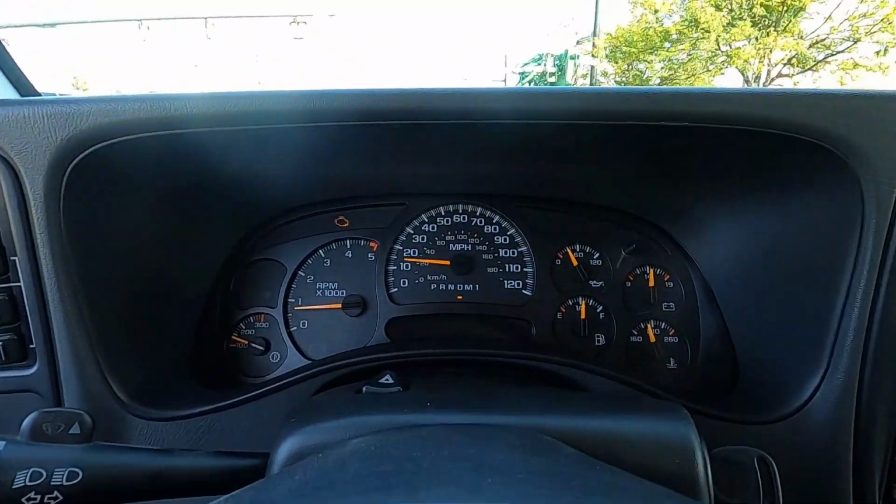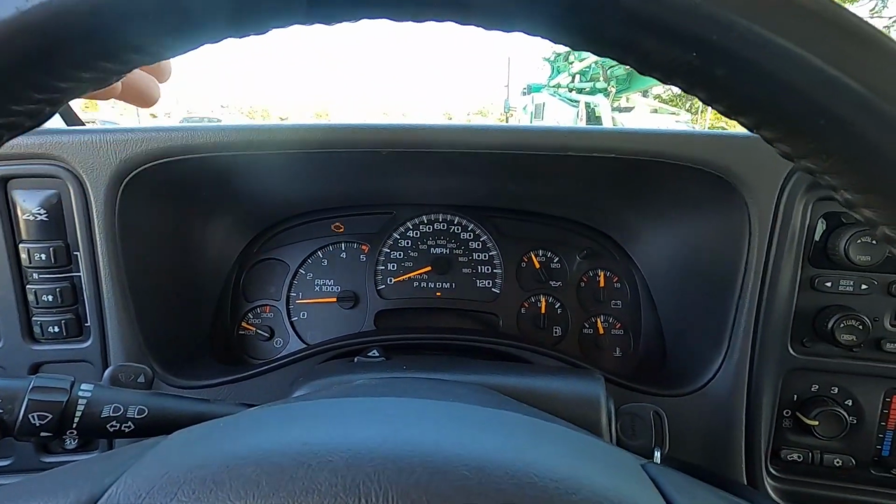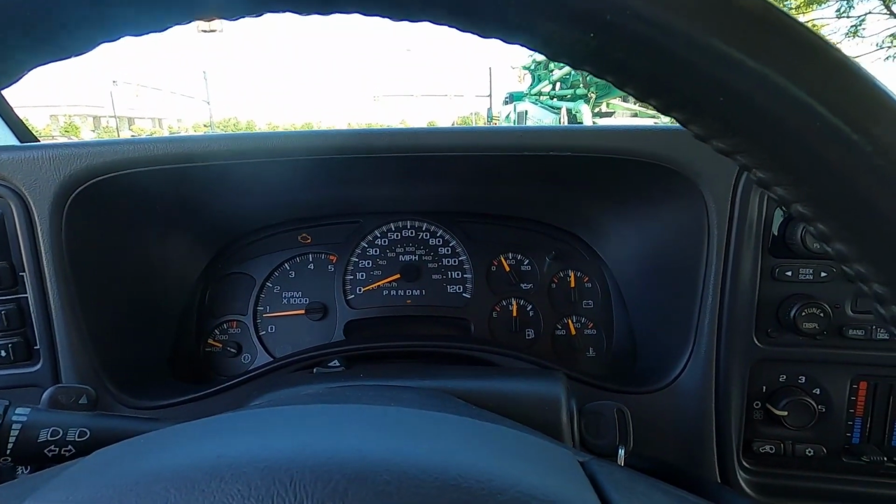This thing is sweet. If you noticed in the last couple of clips, we do have a check engine light on. That is for glow plug number 6. Actually the most inconvenient one to replace. It is right under the steering column or next to the steering column shaft on the driver's side. But what can you do? Everything runs perfect except for that, and this thing does not need glow plugs to start. So these LBZs have glow plugs, but they start with absolutely no problems, even if all the glow plugs don't work. So this thing is an absolute runner, huge accomplishment.